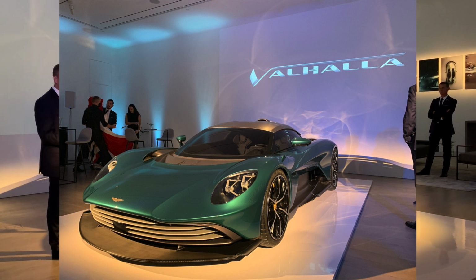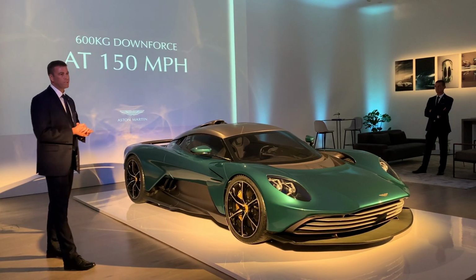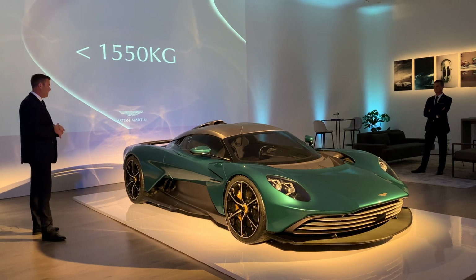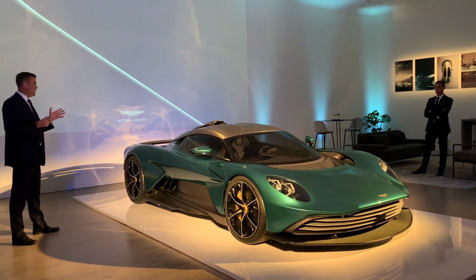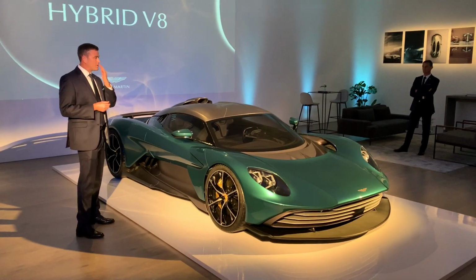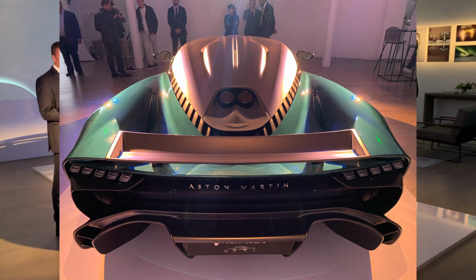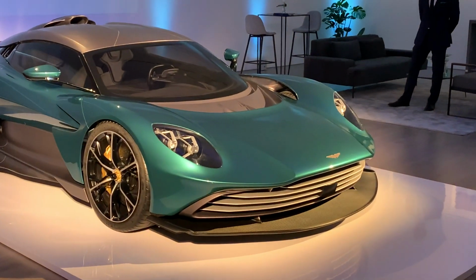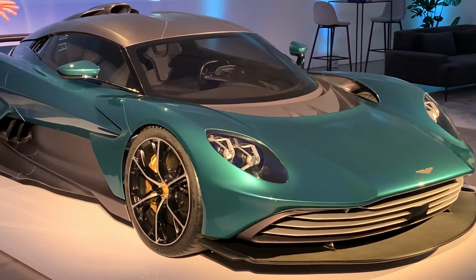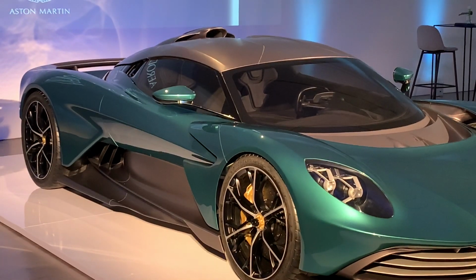So if you have a car that's going to produce that kind of performance, you're also going to want to stop really well. The braking system on the car, we've got carbon ceramic brakes in the front with a 6-piston front caliper, carbon ceramic brakes in the back with a 4-piston caliper. The transmission of the car is an 8-speed dual clutch transmission. It does not have a reverse gear. We let the hybrid system do the reverse, so we can actually just operate the front motor of the car in reverse, and that's a reverse gear. That actually saves us weight with the 8-speed DCT.